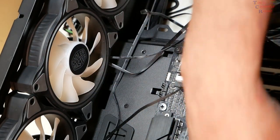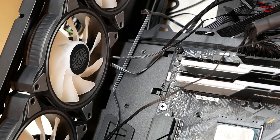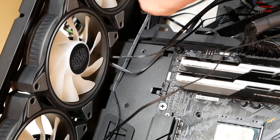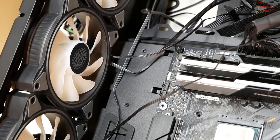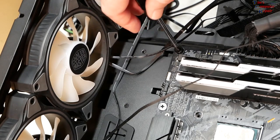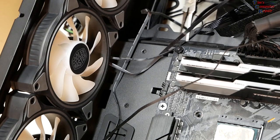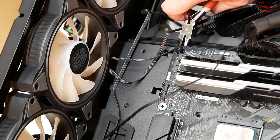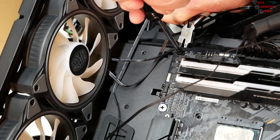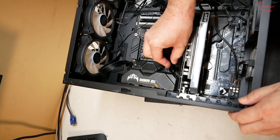What's that? Oh my God. So he's taken these larger screws and cranked them down onto the standoffs so tight that when you go to back them out, it unscrews the standoff from the case. And even when I try to get a pair of pliers on here to hold that tight and to unscrew it, it doesn't come out. I wonder if there's a standoff on this one.